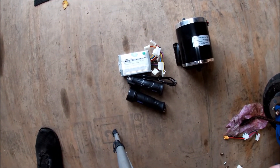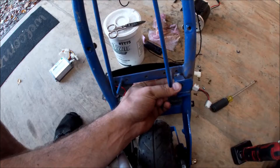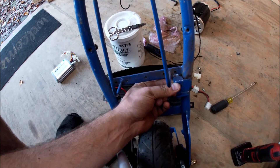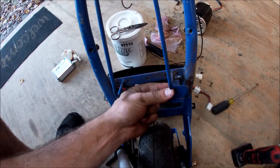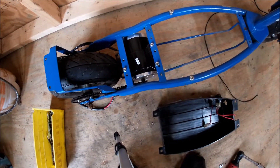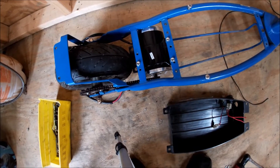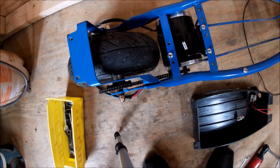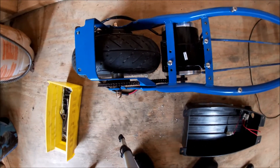Alright, so here are the new parts. I ended up having to take the kickstand off and Dremel the kickstand mount off. The new motor is so big that it wouldn't fit, so I just cut it out with a Dremel tool. I had to do new motor mounts and drill holes — I ended up only drilling three because they're just a pain to drill through that motor bracket. I had to make all new mounts since they didn't line up. It's real close to the tire but there's a little room — not hitting, probably about a quarter inch. The chain line looks pretty good.